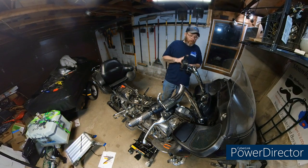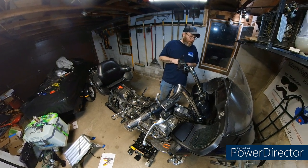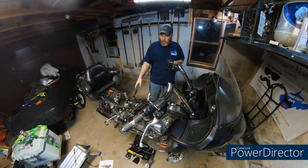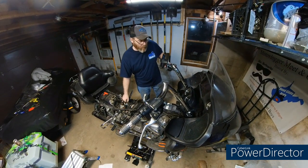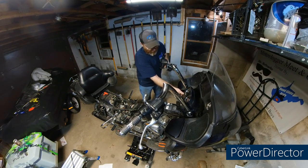Heat grips work. Like I said, remember, don't just go plugging stuff in because it'll fit. Make sure that circuit can handle that and it's not going to throw an overload on your BCM. Be cautious. You'll end up with more problems down the road if you're not careful.